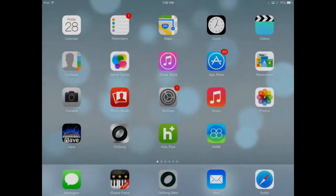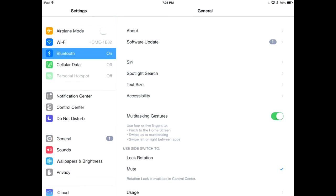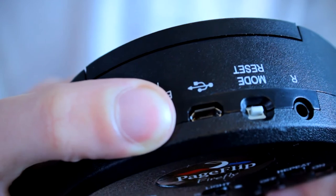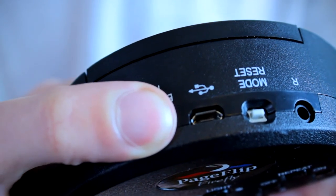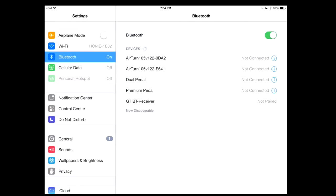Because the PageFlip foot pedal is a wireless computer keyboard, we need to pair it with our iPad first. Once paired, the keyboard will only work with that device, but you shouldn't have to pair it again. To pair, open the Settings app from your iPad's home screen and choose Bluetooth on the left. Turn on the PageFlip Firefly by pressing and holding the Bluetooth reset button on the back — this should make all of the options blink red. The PageFlip Firefly should appear on the list under the premium pedal; just tap to pair the device. To re-pair to another device, press and hold the Bluetooth reset button until the indicator light flashes across all options, which takes about 2 seconds. This will force the PageFlip to become discoverable again.